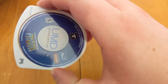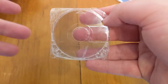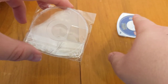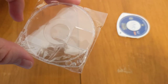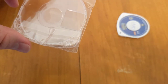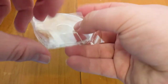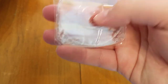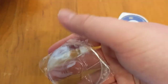Obviously that means this housing is broken. What you could do is just straight up replace it with one of these replacement housing things I have right here. To be honest with you, I hate these things - I think they're ugly, and they use a different type of plastic than what actual UMDs use. So I think they might cause some very minor technical issues when the disc is being read, such as slightly increased load times. Whenever I've had discs that use these types of housing, it seemed like the PSP made a lot more noise. Personally I stay away from these unless the disc straight up doesn't have a case at all - I had a copy of RV that was just sitting in nothing, stuck it in one of these and it played just fine.